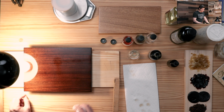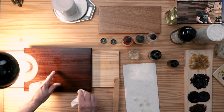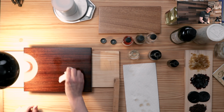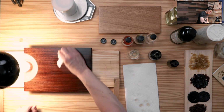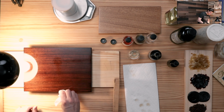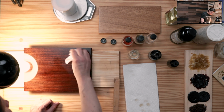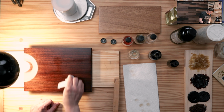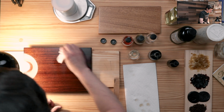There's some other things. Like, if you're dealing with a problem, sometimes a figure eight is nice. So if there's an issue like right here, maybe I would go like that and work it from a couple areas. You don't want to overdo it. And then pull it out when the pad gets dry. And so the paint and pull over goes like this. You go forward, pull it back, and then you kind of overlap a little, go up, pull it back. So try that paint and pull over technique.